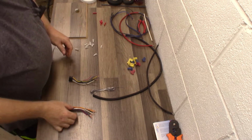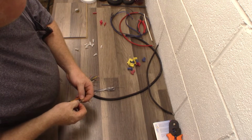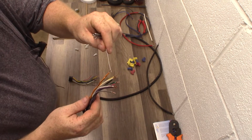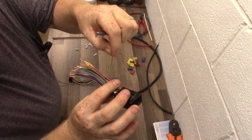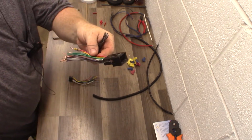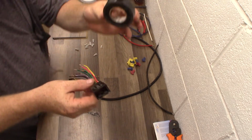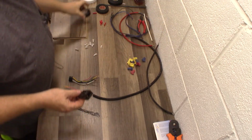Whenever you expose the center of a wire, you open it up for oxidation. It oxidizes, starts corroding, and they can actually lose connection over time. So if you're going to solder, solder at the tips of a wire. Don't try to connect to the middle of a wire. You can try to use silver solder if you do, and then you want to use a typical vinyl tape over top of that. I use 3M Temflex 1700 adhesive.